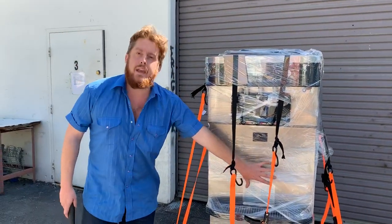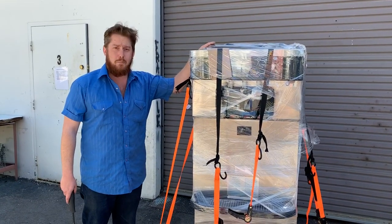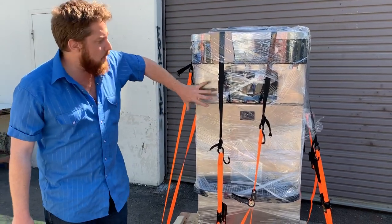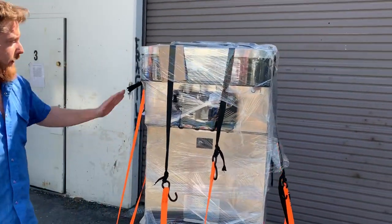You don't really know where the weight is on this unit, and each unit is very different, so you won't be sure of the center of gravity. You really need three to four people when taking out a big machine and getting it off. You also don't want to ever move machines by their plastic face plates or handles — you can damage them that way.